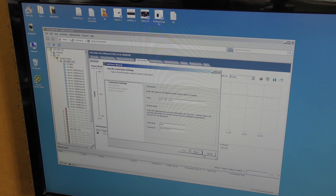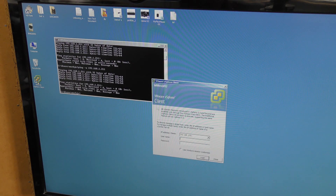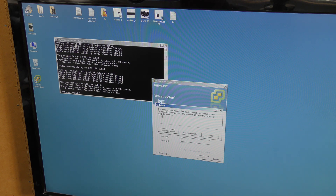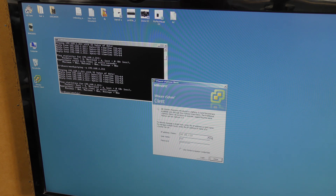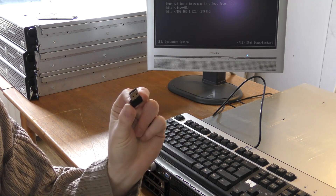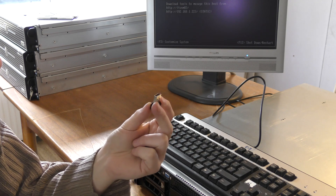Let's see if the vSphere client itself will do it. It wants to install a new version of vSphere client compatible with 4.1, and I don't want to ruin my good 5.5 or 6 setup. So I guess we'll just have to delete everything and install something new. I have a little USB stick here with an ESXi 6.0 installation, so we're going to try that and boot the server.